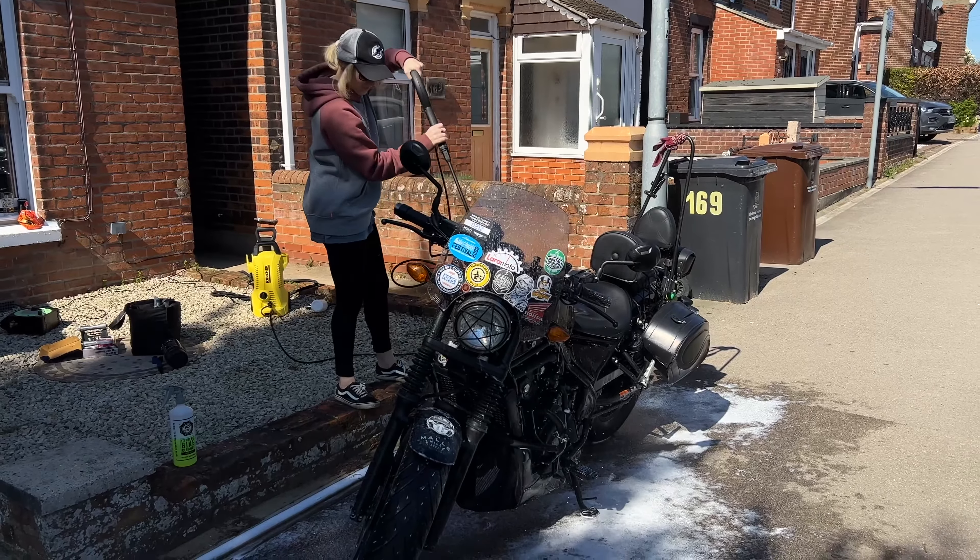Next up — I've just thrown some products at you. What have we got there? Streak-free shampoo by Autobrite Direct, and they also sent me this brush. Now we're going to get out some buckets, put the streak-free shampoo in one bucket and rinse water in another, and wash the bike down. For any nice paintwork just use this good-quality mitt. The brush is really really soft but I prefer to use the mitt on the paintwork. The brush will be on everything else — but not the paint.